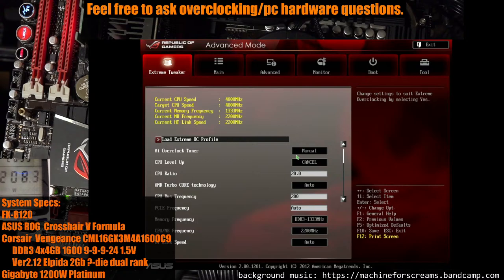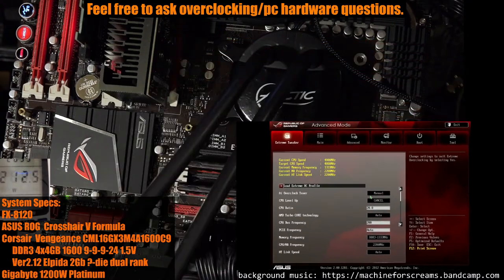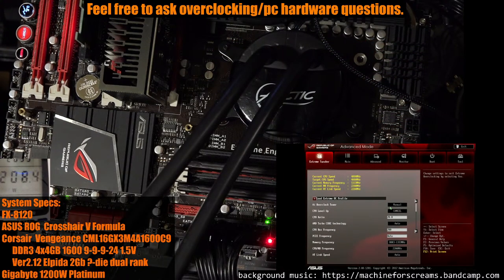I think I might be done. Technically, I could swap CPU. Actually, no, I don't want to swap CPUs. The board didn't come with a backplate, so I'm using some random plastic black backplate that I got from a different motherboard, and it's a pain. It doesn't work with the normal Asetek mounting hardware, so I had to improvise something, and I don't feel like swapping CPUs with that.